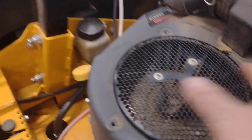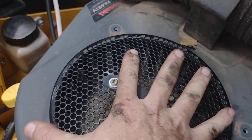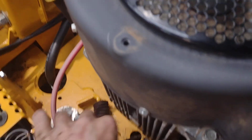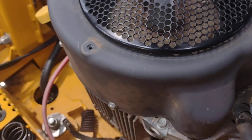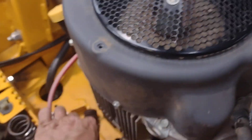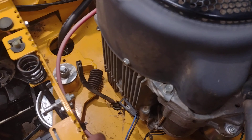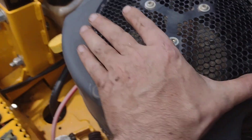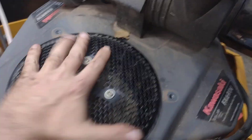Okay, I've got that tab holding the clutch in place — I've got it out. I'm going to give it a try to see if it does anything different. Oh, there it goes! Now the PTO clutch wire comes up out of here. I didn't want to spin the engine over with the starter because the PTO clutch is still on there and I didn't want to destroy it. I just unclipped the zip ties to see if the motor was still stuck, and it is not.